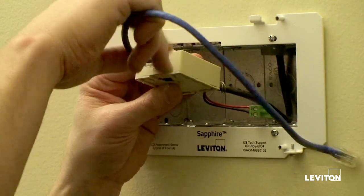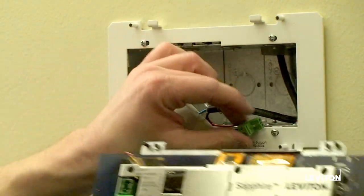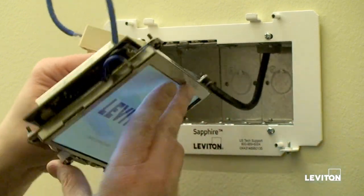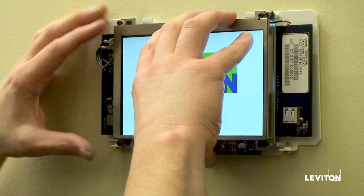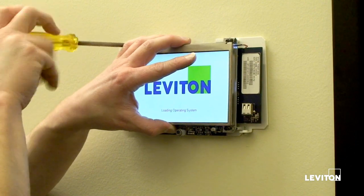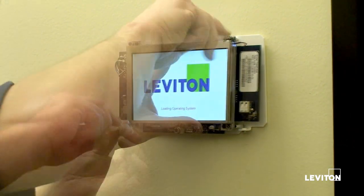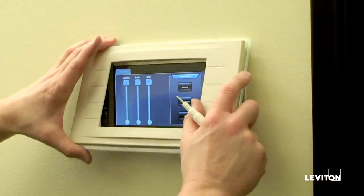Next, install a Category 6 cable — a short one for connecting data between the breakout box and the touchscreen. Plug power into the touchscreen and plug data into the LumiCAN connector. For those of you that are worried about termination, it's done on the front of the touchscreen, so there's no harm moving to this part of the install. Once you get power and data connected, use the four screws to secure the touchscreen to the mounting plate and get them secured nice and tight.